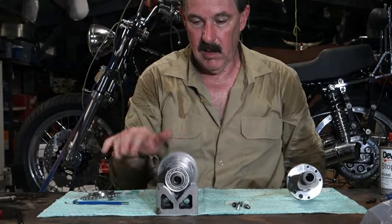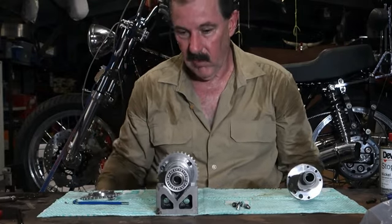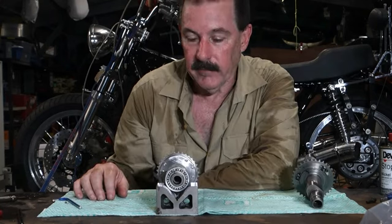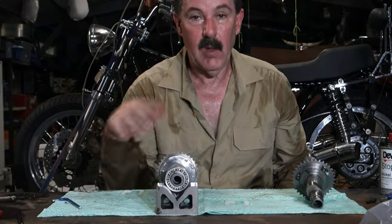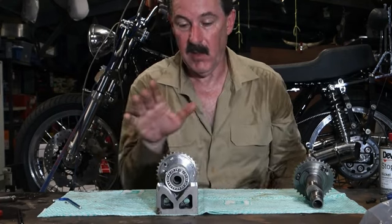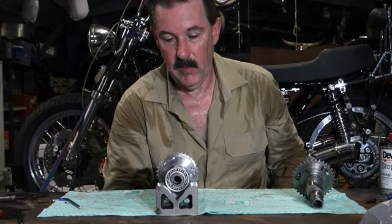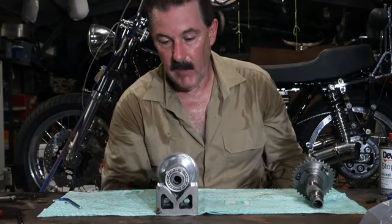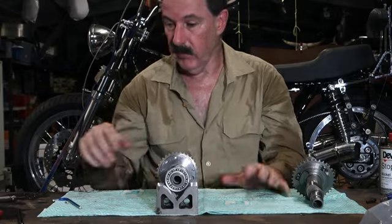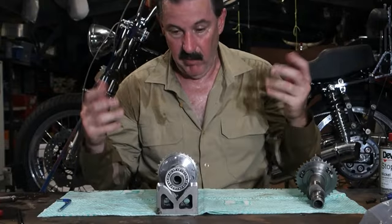Right? But just look at this one more time. Don't know if you can see it from where you are, but it is quite rough in its rotation. There you go, settled on the heavy side again. Give me a minute and I'll be right back. Alright, so I've put all this back together. Let's spin it. And you can see it stops there, doesn't want to roll back. There. Stops at a different place every time. There you go. So the cam is now balanced. As I said, I don't know if it would make a noticeable difference, but I just thought I would do that anyway.